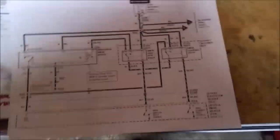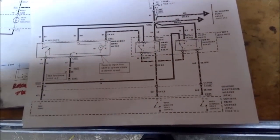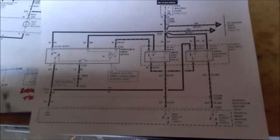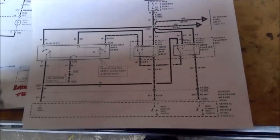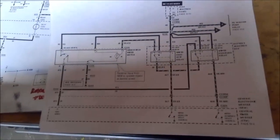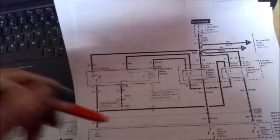The relay control and all that comes from this generic electronic module. Anyway, I can't get it to do it in the shop right now, and it's quite a bit cooler in St. Louis right now than it has been. I'm guessing it's probably the motor getting hot and shutting down for a while, because if you let it cool down it'll run again. But I can't guarantee that without actually recreating it here in the shop or catching it in the act. And he just said go ahead and put a motor in it.